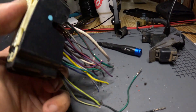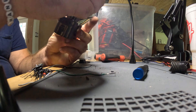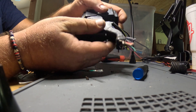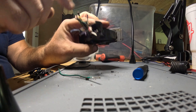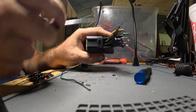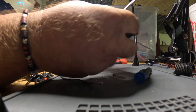When you get to your plug, it'll be clicked in. The back part with the cam — these wires are all bent over like that. The cams slide into the holes and it hooks down with two legs, one on each side, hooked into the case. It's pressed in and this end will be taped. To pin this out: unwrap the tape so your wires are free. Take a small pick or flathead screwdriver, depress the tab, and push up — this will slide out. You have a tab here — press it and push up, and this will flip up and come out.